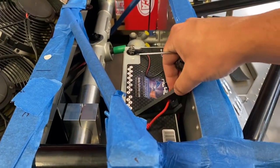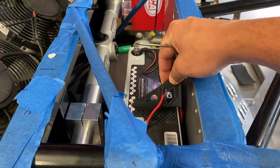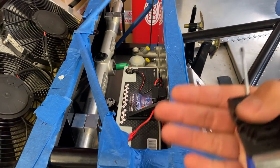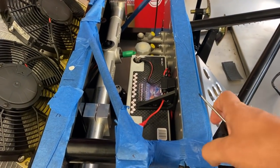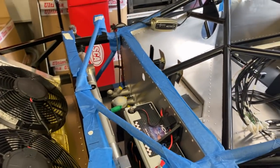Here's a little battery clamp that there's a mounting point in the side that'll go into the bulkhead here that I'm going to use, and you can see I've just integrated a couple of wiring guides there. I always think having that sort of dual use always keeps things more elegant and gets rid of a whole heap of nonsense and rubbish that you end up having in. I mean, if I can do that, it means that I don't have to have additional P-clips and that sort of stuff, which is going to make this all look rubbish. So those sorts of things make sense.